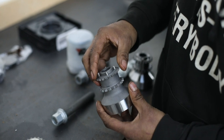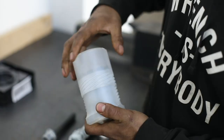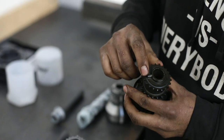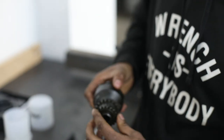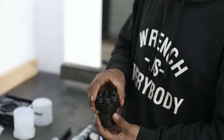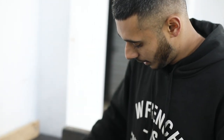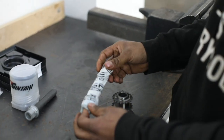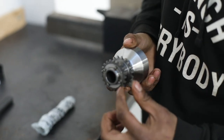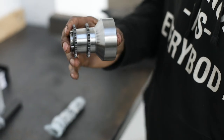The next one is the Max PSI one — almost like a geared setup. We also have the Gintani one, which comes in a nice little carry case. It's fully billet, one piece, and the difference is there's a pin here which we drill into the side of the crank, and that's what locks it in place. We tend to use these on big power builds, going above 1000 horsepower, so past the stage 3 setup — it's the most expensive option, but we do stock them. Finally, this is the one we're going to fit onto the DMO giveaway M4 — a new bolt, fully one-piece billet, with four pins that will lock into the crank hub once we drill the four holes, causing no slip whatsoever. This is the one we tend to fit most often.